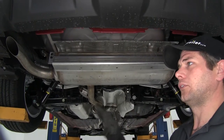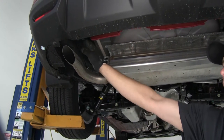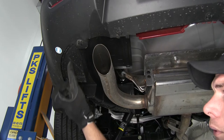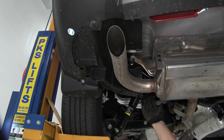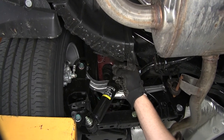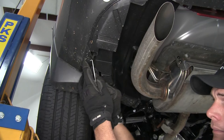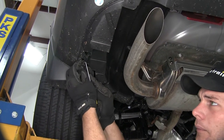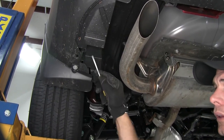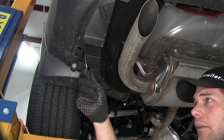Now we'll begin the installation at the rear of the car. We're going to remove a couple of these plastic lower body panels. Each one will have four push pin fasteners and also up at the front there's going to be a Phillips screw right up against the frame. Let's start pulling these out — just pull the center of the core out and then take the other one. We'll remove the one for the side; that will allow that portion to separate. Let's get the two in the rear as well.